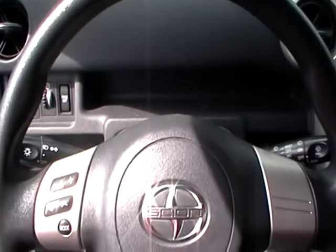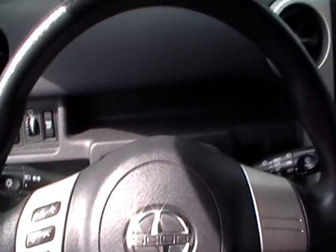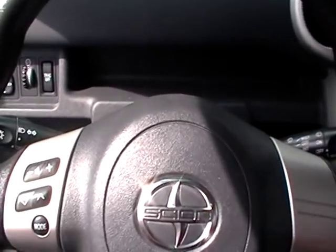What you do is make the steering wheel straight, make sure the car is leveled, shut the ignition off, and get a paper clip.